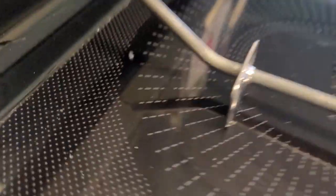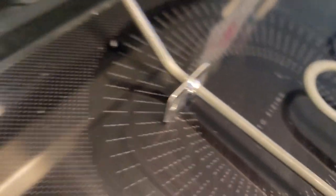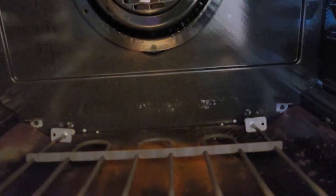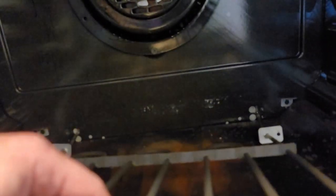This is the new one guys right here. You can see how it angles up a little bit, so you're not going to be able to pull it straight out. You're going to have to pull it out straight and then lift up as the terminals come out — like so.